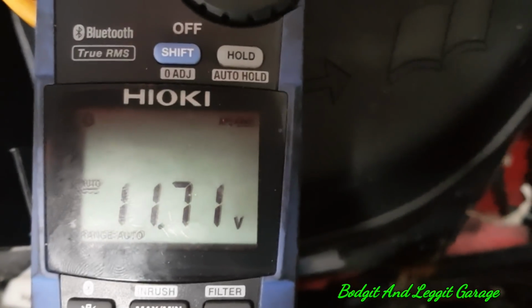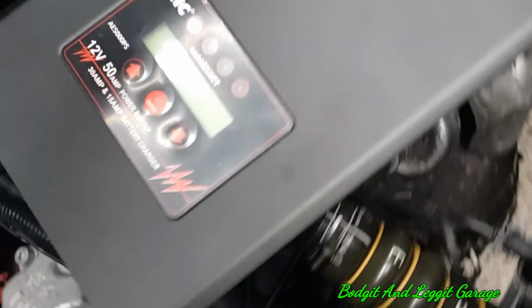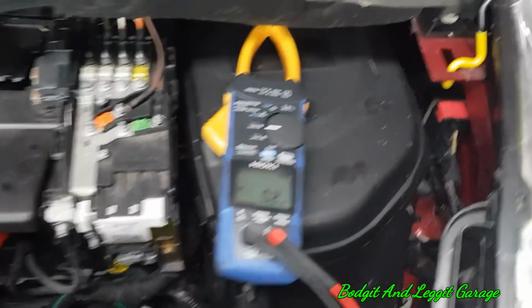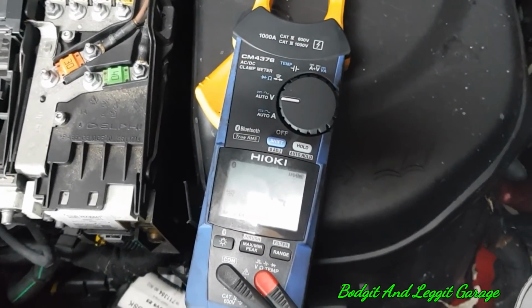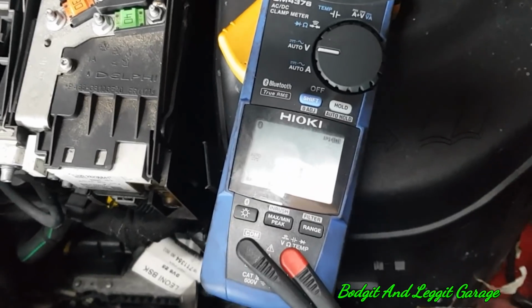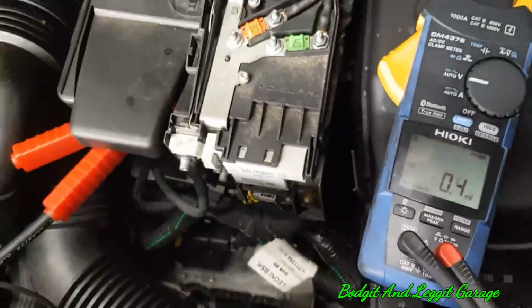As you can see, we're at 11.7 volts. So I'm going to stick a battery maintainer on this. The one I'm using is the one I got from Hobby Tools. I'll put a link down in the description, but this will keep the battery maintained for me, and we're going to be able to get into our diagnostics and see what's wrong with this vehicle. But it's vitally important, always put a battery maintainer on. In this case, it hasn't communicated. In some cases, it might communicate and give you the wrong readings.